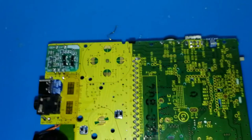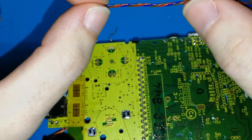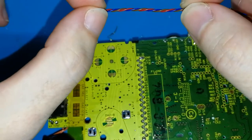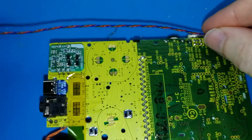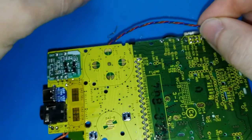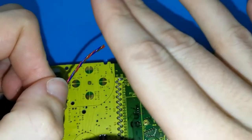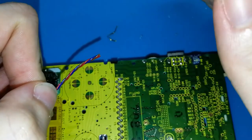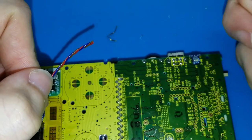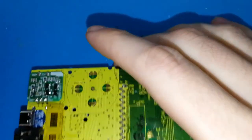And this cable is longer than you need, okay? Because you need to put from here to the board. You should have 3, 4 centimeters more. This doesn't mean you need to keep it, no. You have to cut it to the correct size. Why is it longer than you need? Because maybe when you are taking out the plastic, you can cut too much and cut the cable. So you need to cut again and cut again. So you can try 2 or 3 times maybe, no?